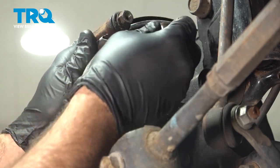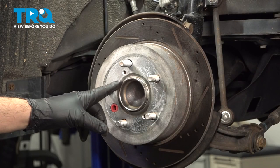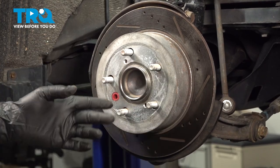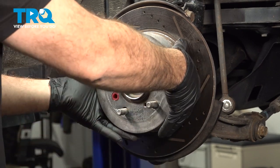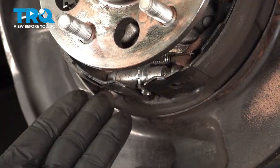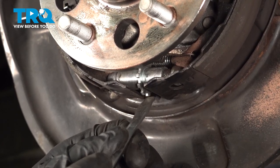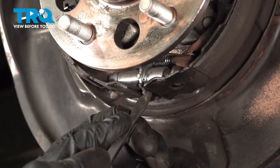Get this bolt out and slide your bracket off and set those aside. Now if your particular vehicle has two set screws located here holding your rotor on, you'll want to use your Phillips head screwdriver to loosen and remove those. Ours doesn't have them. We're just going to work our rotor off and set it aside. On the bottom side of our e-brake shoes, there's going to be an adjuster wheel with a little star on it. We're going to use our screwdriver to rotate this so it screws in on itself, releasing pressure on those brake pads.